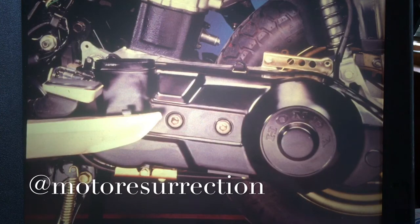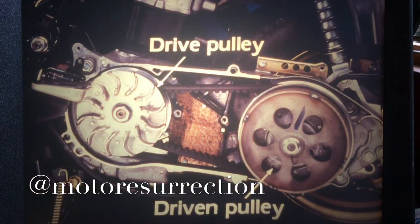Now let's look at the Elite's V-Matic automatic transmission. It's similar to last year's CH125, but not identical. The V-Matic is a belt-driven torque converter system with a wide range of torque multiplication for overall good performance. The drive pulley is on the end of the crankshaft, and the driven pulley is at the input of the final reduction.